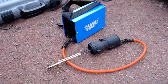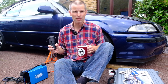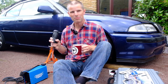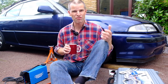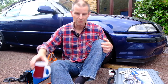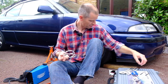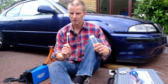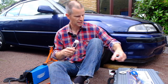This is an induction heating tool. The idea is instead of having an oxy-torch, which will potentially catch the car on fire and be quite a pain to use, I can use a focused intense amount of heat to break off these bolts on the car and get those shock absorbers off. I've been reading the instruction book and it's incredibly simple to use. You plug it in, turn it on — well, before you do that you choose your appropriate heat attachment. You've got two different sizes for going over the ends of bolts, used two or three millimetres around it to avoid actual physical contact.